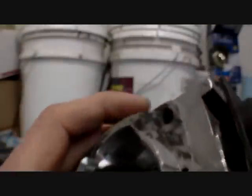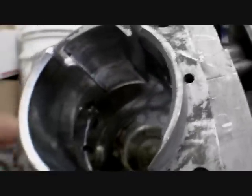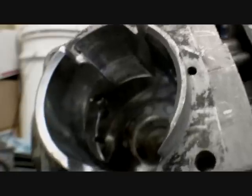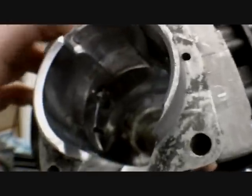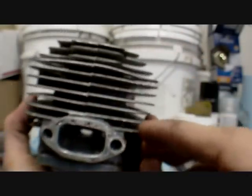But by creating little burrs on the side, you don't just sand it down and just keep it like that. No, you have to make it so that, as you can see here, the walls of this aren't sharp. You round the walls or the ends of this port so that the cylinder does not get caught up on them. So with porting, you want to make sure you don't go for volume and size.